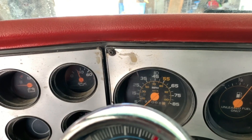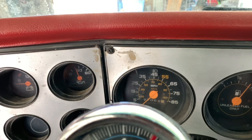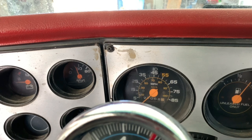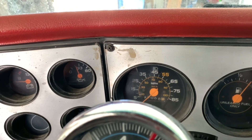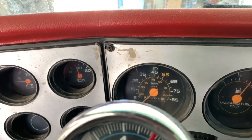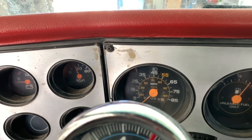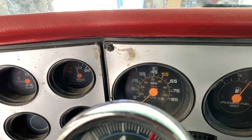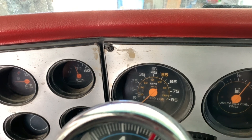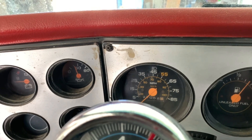Just a final thought before I close this video out. I really enjoy driving these old trucks with the factory gauge clusters. However, they are not digital and they are not precision instruments. Over 30 years of research, I've come to discover that a coolant temperature gauge can vary as much as 5 to 10 percent, even with the proper circuitry and the correct sensor installed. Anyway, just food for thought. Thank you for watching — like and subscribe. If you've got any questions, complaints, or want to talk about your favorite flower, leave them in the comments below. From American Outdoors, we will see you again soon.